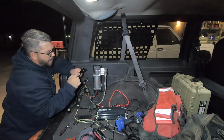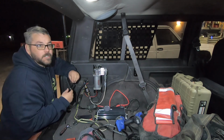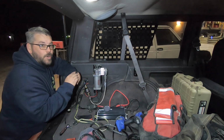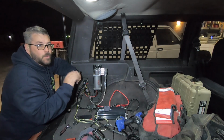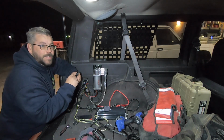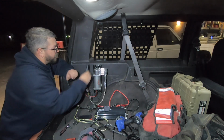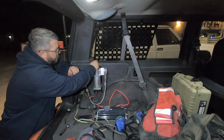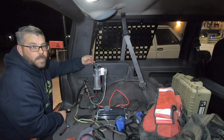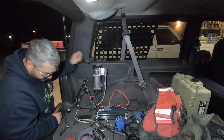All right, I'm going to go ahead and take this bend and make it a 90. So trying to get the perfect angle didn't quite work out, mostly because you don't want a sharp bend in the metal. You want it to be a sweeping bend. If it's sharp, it causes a stress point. That's where it's going to crack and cause problems. I just put a nice gradual bend in it, so hopefully it'll all fit perfect, just like that. The only way I'm going to know is to go ahead and completely mount it. So here we go.